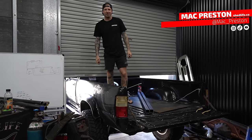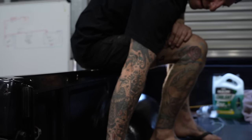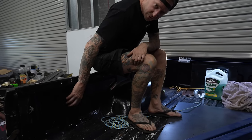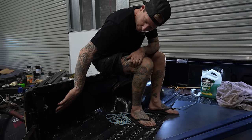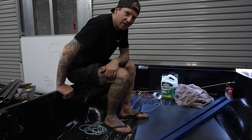I reckon it dropped maybe 10 mil so you can probably run it. In mine, I made brackets that went down, bolted to the floor and bolted to the tub, and then we welded to them. TJ's not faded so we're just going to weld straight to this inner skin — we'll have it welded there through the middle, it ain't going nowhere.